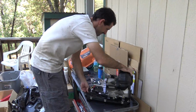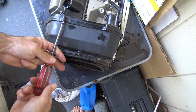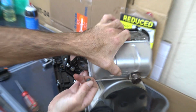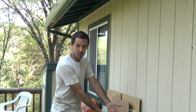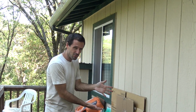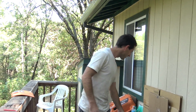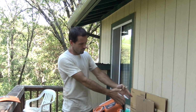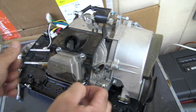I've been contemplating a little bit while taking this apart, and something has been nagging at me. Usually, when an engine stops running, it's because of a single failure. Maybe it loses spark, maybe it runs out of gas, maybe the piston seizes in the cylinder and the flywheel can't overcome that friction. With this motor, there's an obvious problem. There's almost zero compression. But that really makes me wonder if there's an issue at all with the ignition system. Even though my ohm meter read infinity on the spark plug, it is a resistor type, so maybe it just didn't register correctly. Whatever the case, we'll continue on course, taking apart the engine and having a look at the mechanicals, and if there are any troubles with the electrical, we can worry about that later.